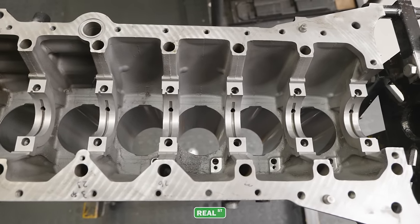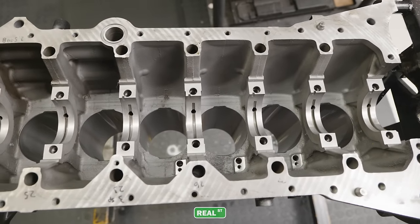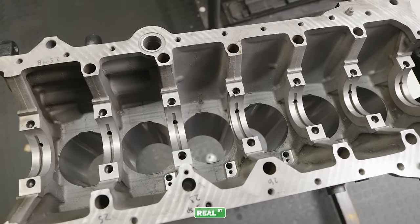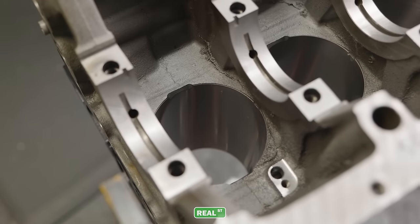The block work was machined at Masworks. It's a GE block but we've converted it to GTE. I won't use the piston squirters on this particular build, but it is handy to have the oil galleys on the exhaust side of the block for turbo feed and/or oil pressure sensors.